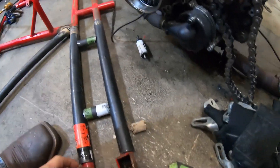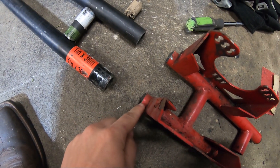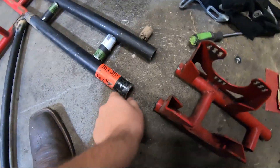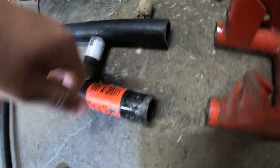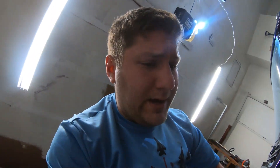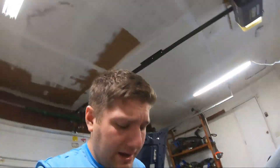What we've got to do is shave these down so they can fit snugly in here - get some slip action going on. We'll hollow out the inside of this pipe a little bit with carbide bits so these can slide right into those, get some welds spun up around them. Do the same with the other one, add some more supports through the frame to support this motor's horsepower and torque, and get some seat mounts fabricated.